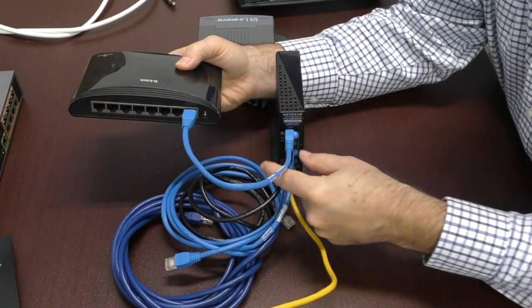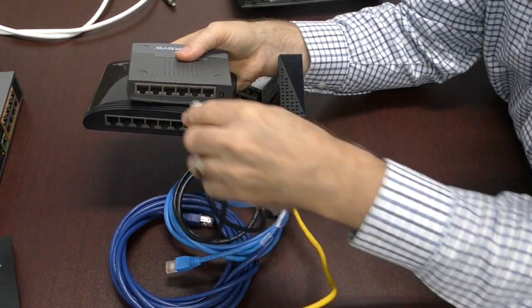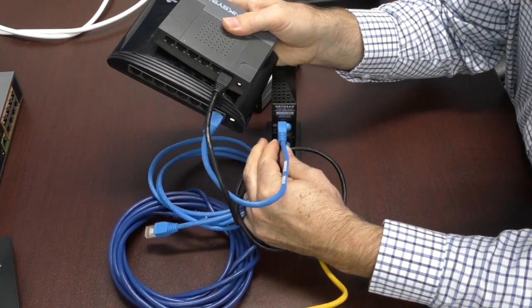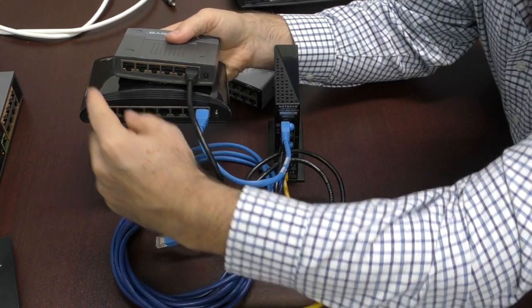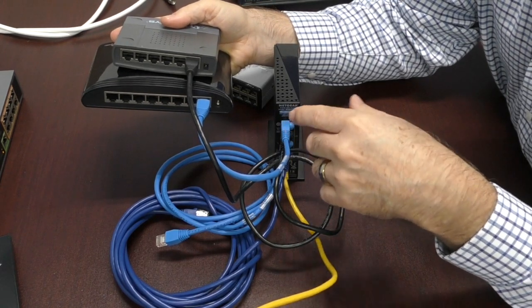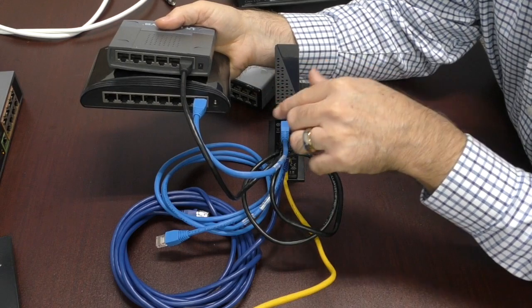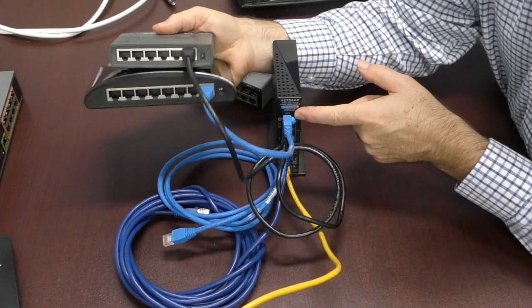It's okay to go from your router to a switch. If you needed to add another switch, you could take another computer out and add another switch, running a patch cable from that switch into one of the router's switch ports. One thing that sometimes comes up is: can you put a switch off of a switch? The answer is yes, but try not to do that — it degrades performance. Once you've daisy-chained about three or four times, the network performance gets so bad it becomes unusable. So if you're going to add multiple switches, try to have a direct connection from each additional switch back to the router.